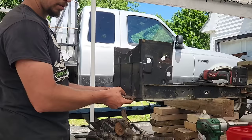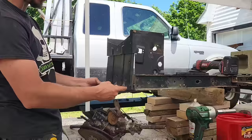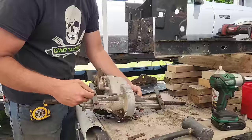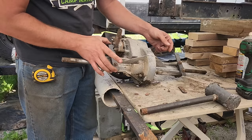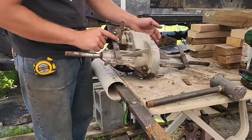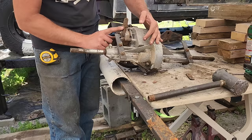I did this part with a regular grinder even though a plasma cutter would have been way faster, but I just wanted to prove you can do it with just a basic $15 grinder. What we've done on the end of this is we took one of these from an old MTD, templated it, and made these five inches long to drop it down just a little bit to get the axle below the frame. We had to cut out for this - one thing we found out when we built the original gas-powered power wheel was that these brake calipers on these MTD transaxles can actually be flipped to go to the underside.